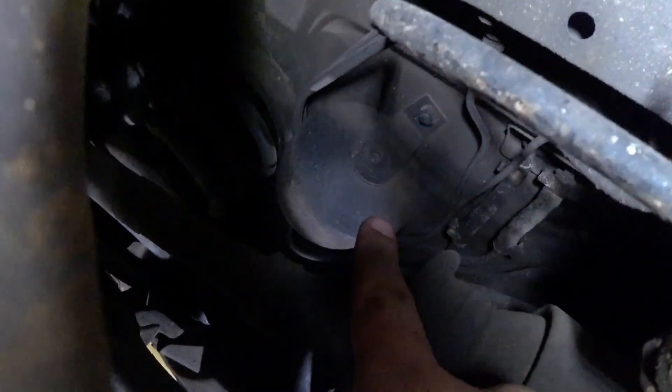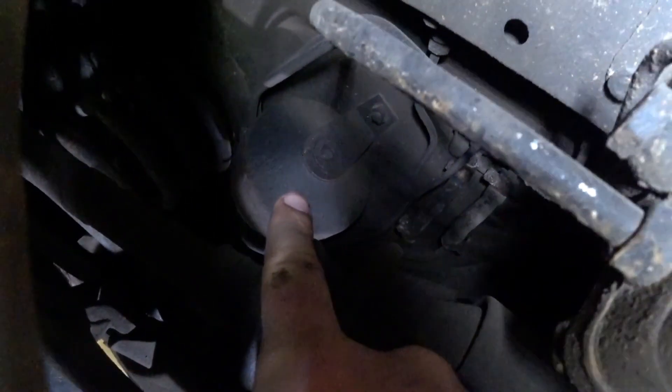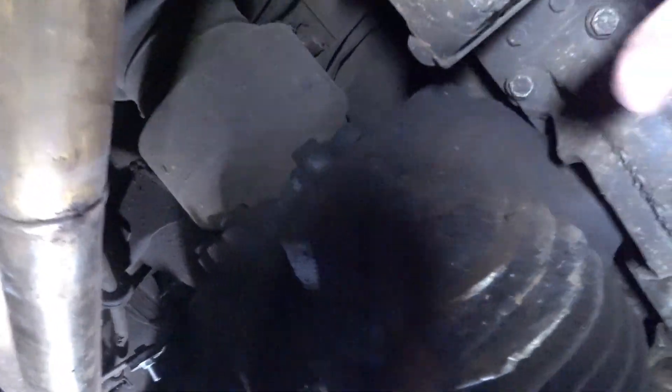There is the other side accumulator — the other sphere. There is one for each wheel. If your car is a 6.9, the very good 116, you're going to have four or five spheres. This one has just a rear suspension — the hydraulic system.